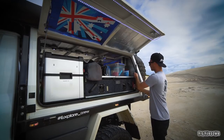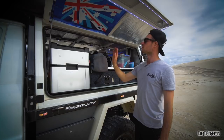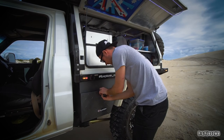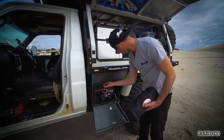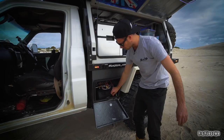There's a bit of a roll bar going on in the back — it's actually to support the spare tyres because the canopy is alloy. I've used a steel frame to support the weight of those tyres, and it also — when I roll it — will save the back. There's also a 1000-watt inverter, fuses, isolated to turn the whole thing off, and the whole thing plugs in with a trailer plug and an Anderson plug for signals and power. I've got my compressor in here — it's the Airbag Man kit — so I can turn this on and raise and lower the height of the back. There's an air tank as well so it holds pressure. I can raise the height of one side, drop the height of the other, so if you're at camp you can level it for the tent, or just bring it back up to standard for the weight of the canopy. I've also got that bag so I can pump my tyres up, and she's all watertight in there.